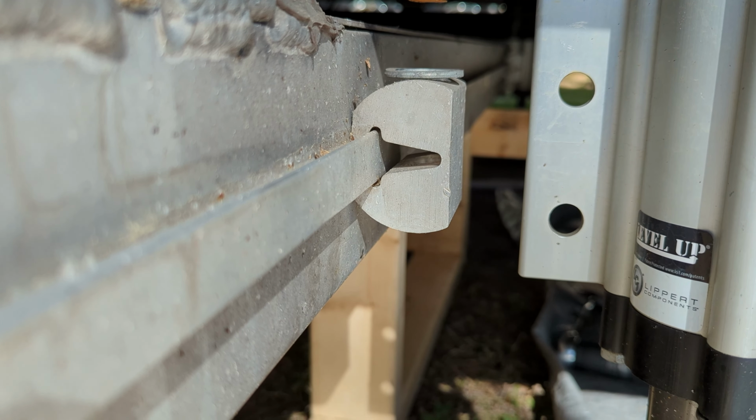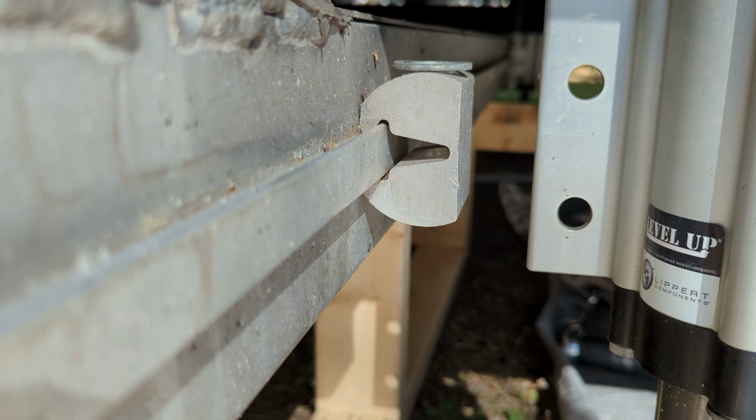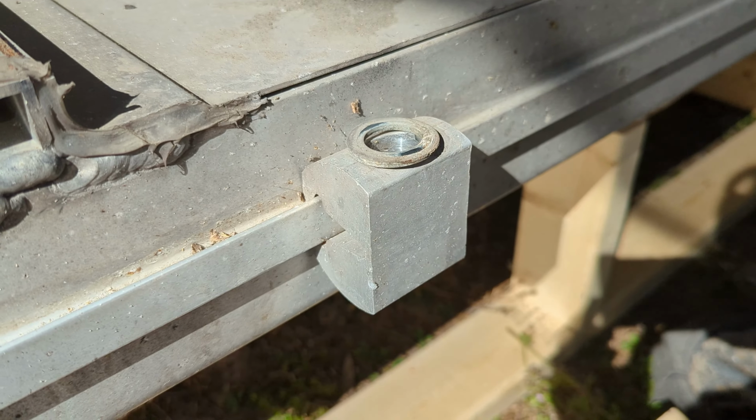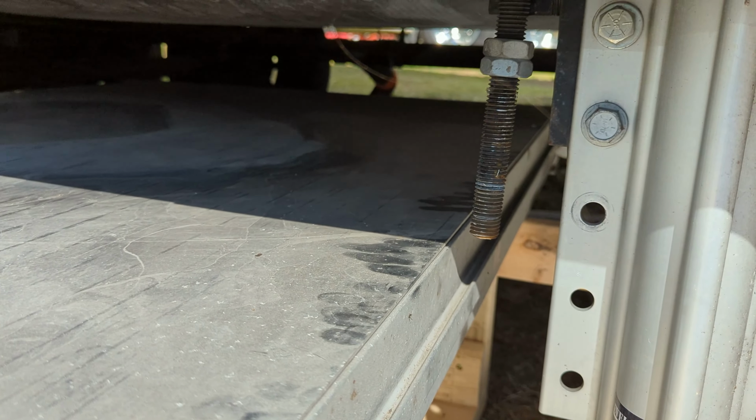But just those 4 bolts holding it up, and those collars slide on this rail. Those collars right there. And then you want to use both those nuts to jam it. Hopefully that helps some. I'm just sliding this whole sled out, so I think what you can do is just lay it on this sled and then push that whole thing under there. Just want to point out right there, washer goes on top of that collar before you go up against that jam nut.